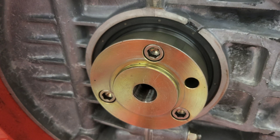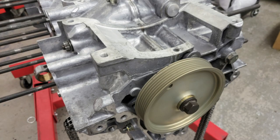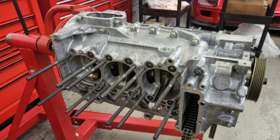When that's done, the outer part is removed and the tool can be completely removed from the end of the crankshaft. Here we see the seal in place. The final thing to do is fit a pulley onto the end of the crankshaft, because the engine is going to have to be turned over when we fit the cylinders and liners. So there we have it — the crankcase is assembled, all bolts torqued up, cleaned, and with both seals fitted.